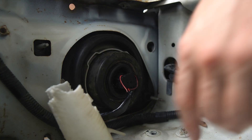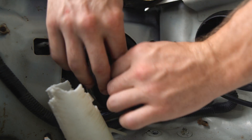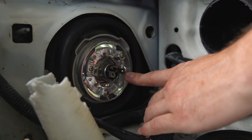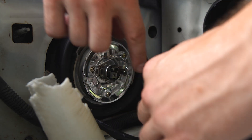How about this camera angle? Finally. Now I'm going to pull this back a little bit and pull this connector off of its housing. You can take this rubber casing off — it has a little clip, you just push down and pull it to the side, and that should allow you to pull that back and access the bulb.